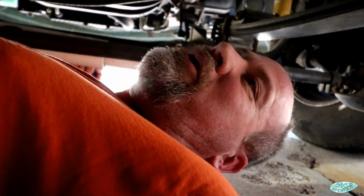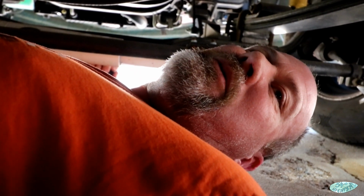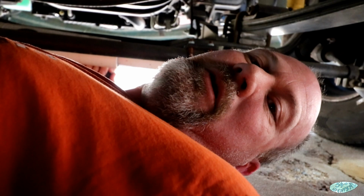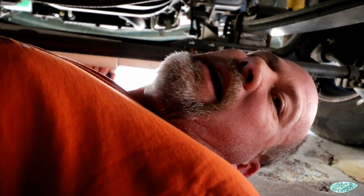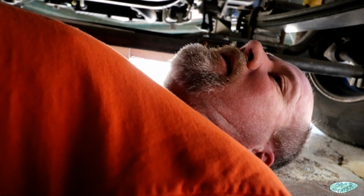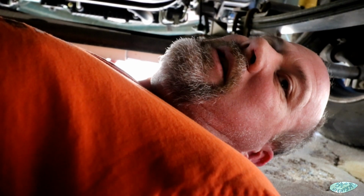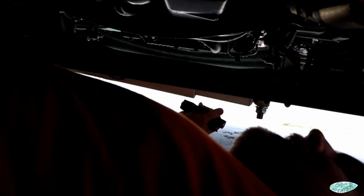Just wanted to give you a look-see at the three things that we have done to this F53 chassis, which is what a lot of the Class A motorhomes are on now. A quick look at what we did to improve the handling performance of it. There were three things. We did the Saf-T-Steer, the cheap handling fix, and a Trac Bar. First thing, let me show you the Saf-T-Steer. It's this massive white shock absorber looking thing.